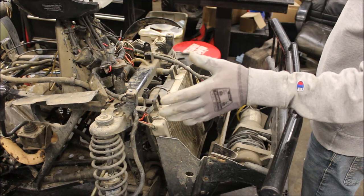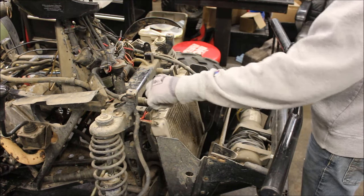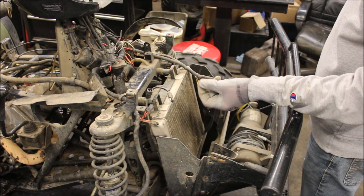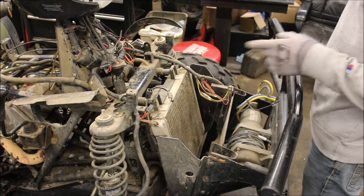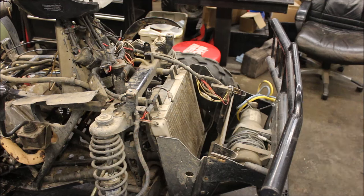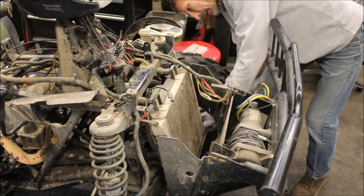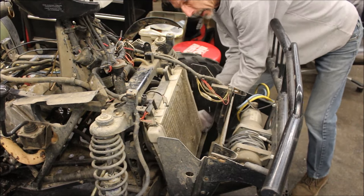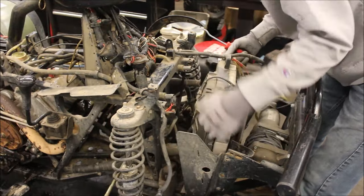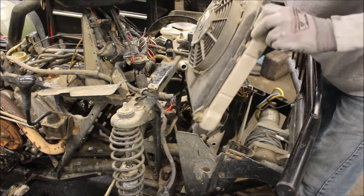That's why I checked the impeller. I think all this black melted stuff got stuck in the radiator. The radiator does look good on the outside — I could try to flush it out. But with those little black rubber melted things in there, it could be stuck somewhere, so I don't trust that radiator. I'm just going to pull that completely out. I got one on order. One radiator removed.